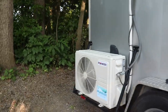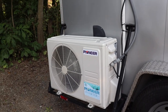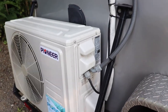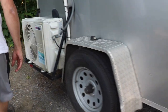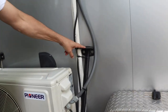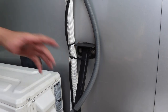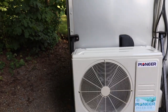Here's the mini split. Was that hard to install? No. I was trying to use everything I had sitting around because I didn't want to buy stuff — that's how this frame came about. I had a two-inch piece of angle iron and I had this laying around, so I made my bracket out of just that. It's bolted right to the frame. This has a three-inch tube that runs pretty much all the way around, and I have a little tie-down mounted right there. The beams underneath are only about an inch and a half, so one bolt goes to that beam and then I put a little support plate over there on another three-inch beam.